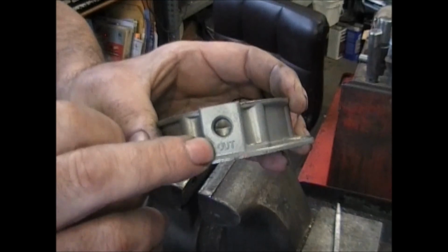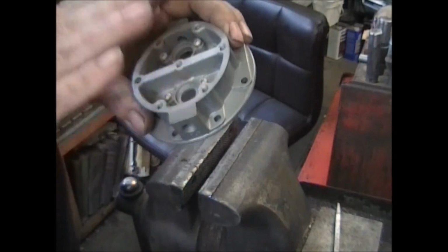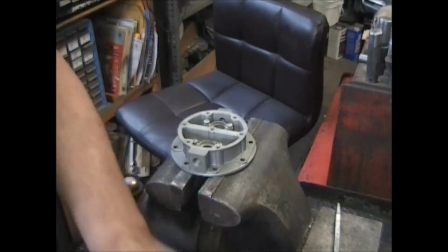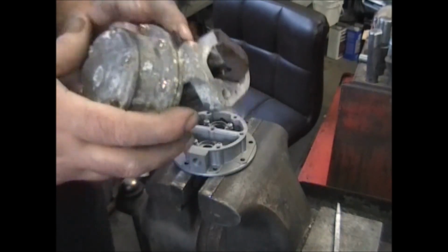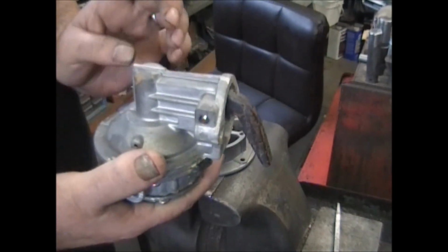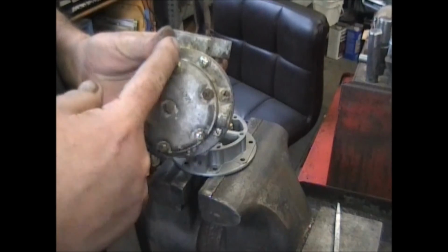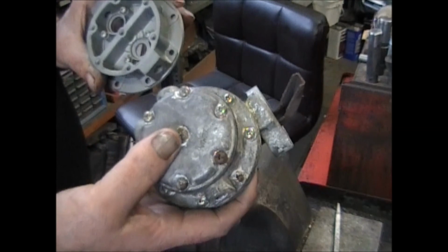As you can see, it says out, but once you get the valve in, you can tell that the fuel is going to come up through, hit the pulsator, and get shot out through that hole. It goes up to your carburetor. The inlet is always at what I call a 9 o'clock position, because you hold the pump upside down, and it could very well go on the engine this way here. I have no idea. I've never seen one on the engine. But when you're working on it, it's upside down. And 12 o'clock, 3 o'clock, 6, and 9. The inlet is always at the 9 o'clock.